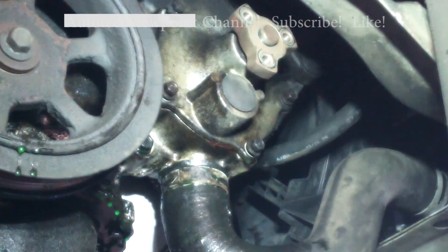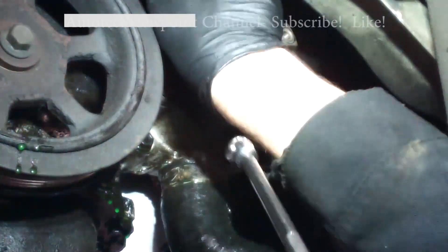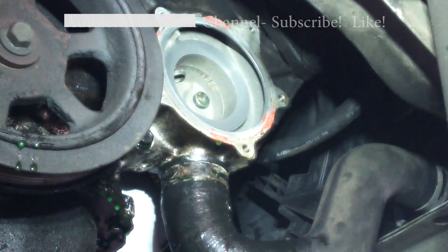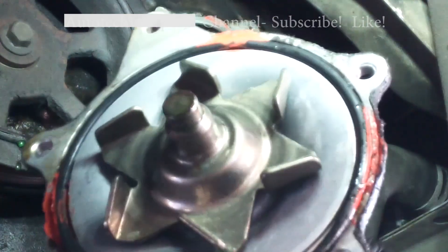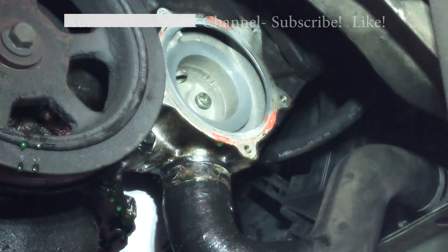The coolant is out and we're going to take out the water pump. You can see a little silicone there holding the old gasket in place — that's actually a good example of tacking it. So we'll use a little sandpaper and maybe a razor or scraper to clean off the material on the mating surface before we install our new water pump.